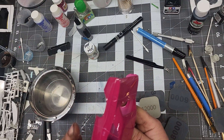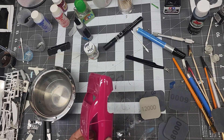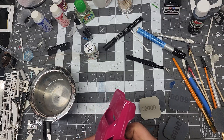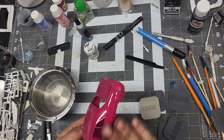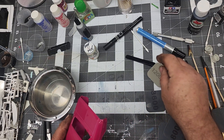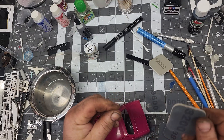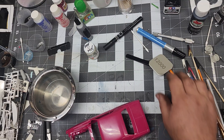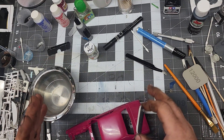This side is pretty clean; it's just one spot. But if I'm going to do part of it I'll have to do the whole car because you'll notice the difference. This is the MCW enamel and it's hard as a rock — the hardener makes it tougher to sand. In automotive painting you didn't want to wait too long to wet sand, because once it cures it gets really tough. We'll start with the lowest grit and work up from there — starting with the 3200, though it's getting pretty worn, so maybe we'll go straight to the 3600.